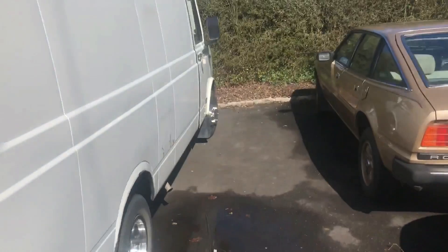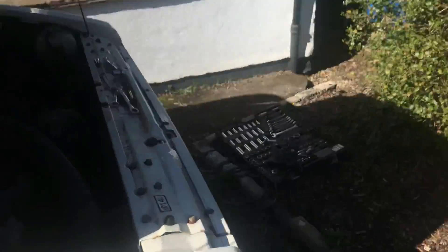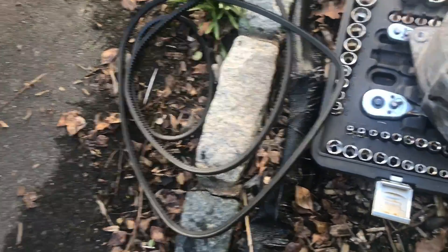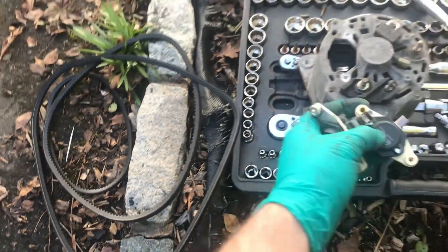Just got home. Battery voltage indicated now 11.7 volts. I was also getting some squeaking from the fan belt as well, which isn't normal. Well at least it's sunny now. Alternators back out again - I've taken all the belts out because they scream. One of them does anyway, and it's very old and cracked, so I'm going to get them all matched up.